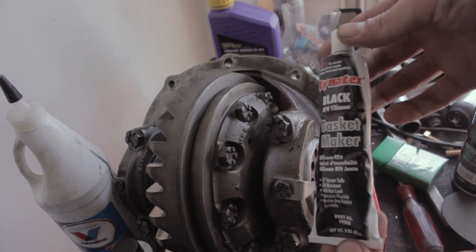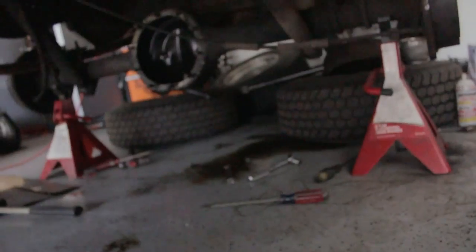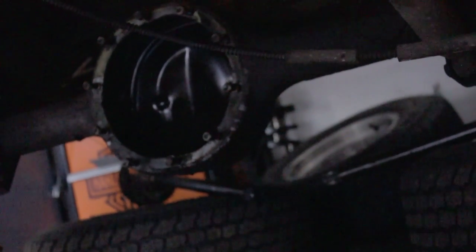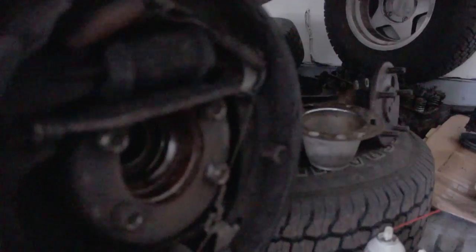With the traction lock differential they gave me this additive to put in, then top it off with the 80W90. I was told by them and others that using the gasket for this is pretty much a fast track to leaking, so they also gave me a tube of gasket maker and I'm just going to use that instead. This whole third member folds right up to where that big hole is up there — the whole unit plugs right into there. It's nice and clean inside, which is a good sign. You have to remove the drums, unbolt the axle bearings, and pull the axles out before you can put it in — you can see them laying over there on that tire. Then once it's in, we put those back in. That's what I'm doing today.